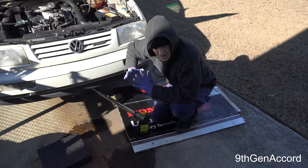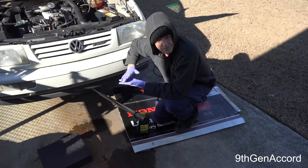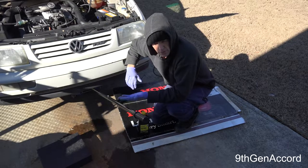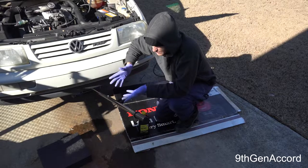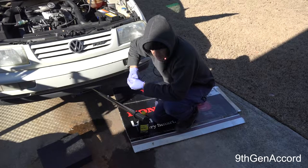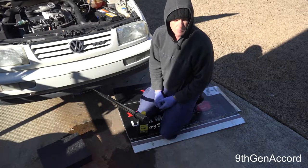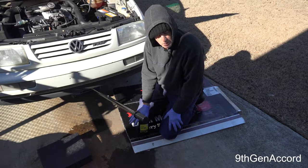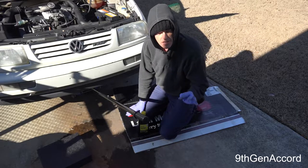How is this possible? Well, brake fluid absorbs moisture. When you look at a car that's got a couple of years on it, the brake fluid should at most look slightly honey-colored. But if you see a lot of cars with neglected brake fluid, it's got a lot of moisture and oxidation from the heating and cooling cycles and the heat generated from braking — it's going to look black, almost like motor oil. You don't want that. Brake fluid is almost clear, and at the end of a year it should have just a slight honey-colored tint.